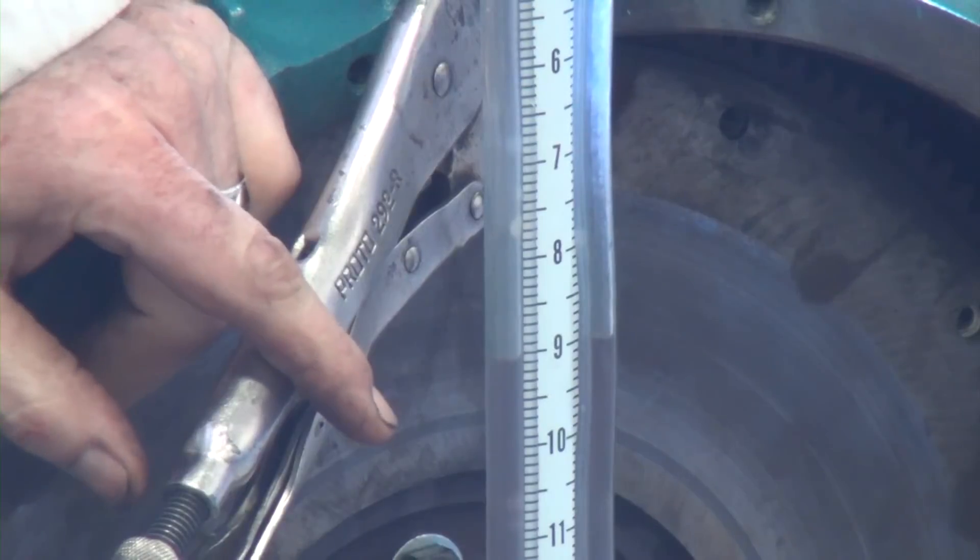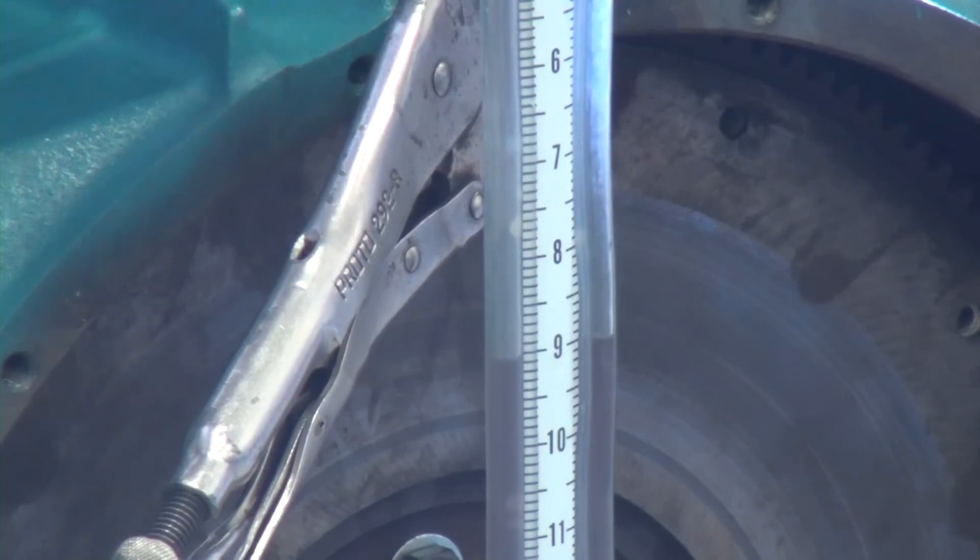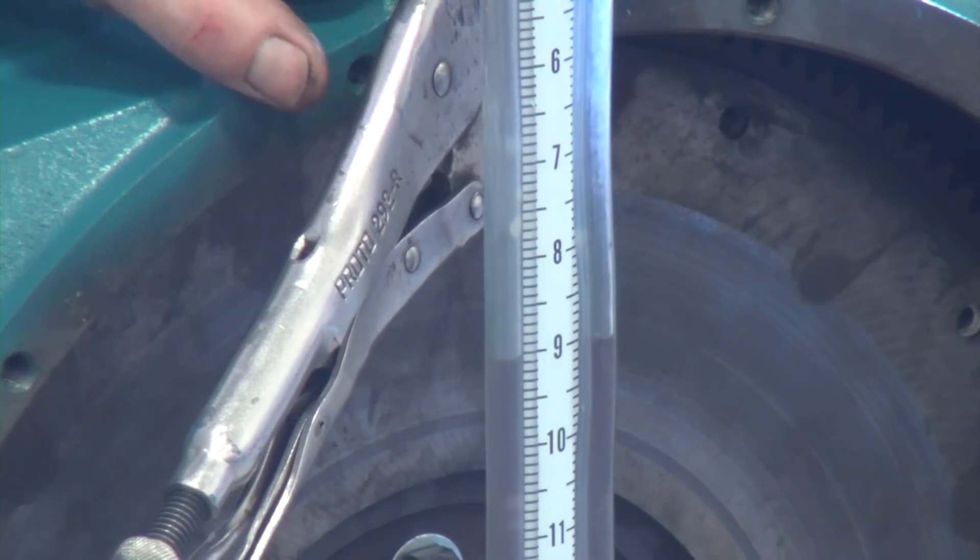As expected, I'm getting a very slight bit of movement — very similar to the digital reading — probably because the engine is fairly new. There is a bit of oil coming out the exhaust, likely from a small amount of blow-by in the cylinders causing some oil burning. But the engine does have a lot of compression pressure. It is a fresh rebuild with new pistons and rings, and the valves were redone on the cylinder head. This was a very problematic engine; we did a crankcase blow-by test on it, it failed, and that deemed the repair necessary.